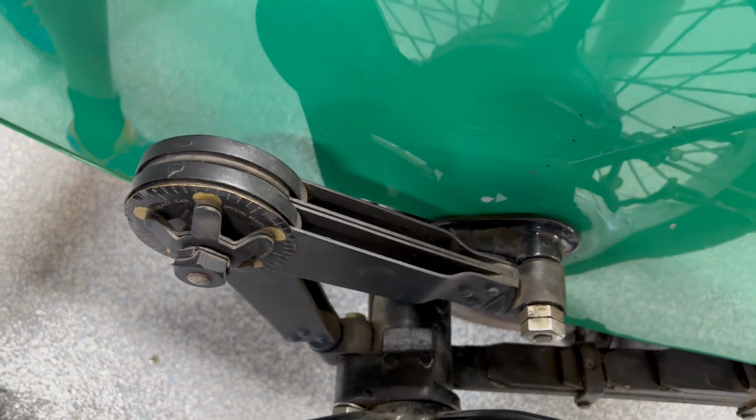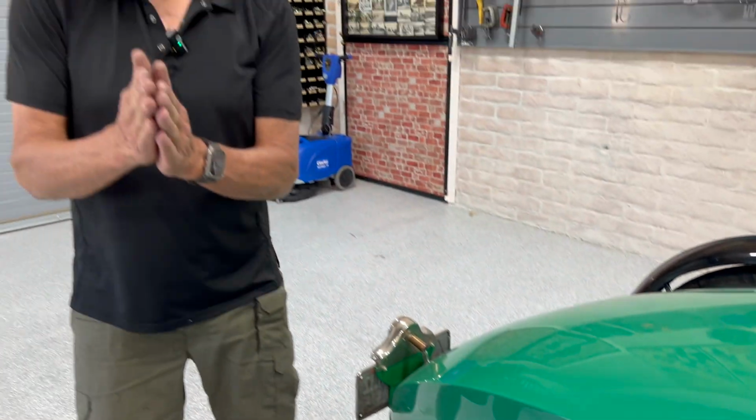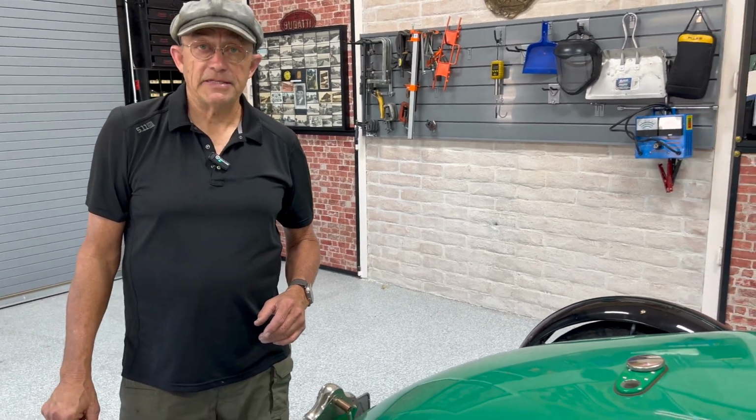No, I can only adjust the tension, how much it springs. On the back friction disc, whether it be asbestos or whatever fibrous material you are using, you're tightening that. The more you tighten it, the less travel you're going to have. So you can mark it with a ribbon or something and see how much stretch you're getting, and match it to that race course. So it's a clamping tension kind of a thing. Yep, that's exactly what it is.